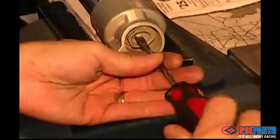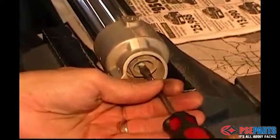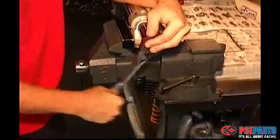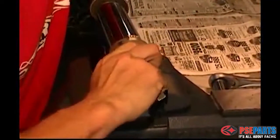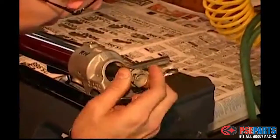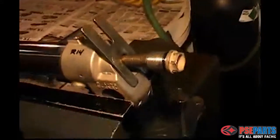Now screw the damping adjuster all the way open to the left until it stops. And now you'll need a large ratchet and socket to remove the damper rod holding nut. Now you'll need to compress the fork with your left hand and push it in while preparing to grab it with your right hand. This requires a special tool, but you can use a crescent wrench or some other open-end wrench to grasp it and pin it as shown there in the video.